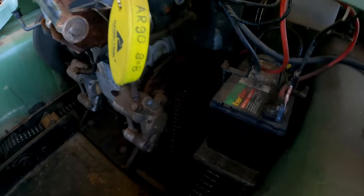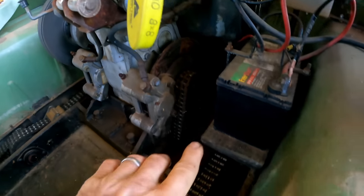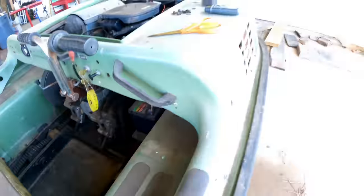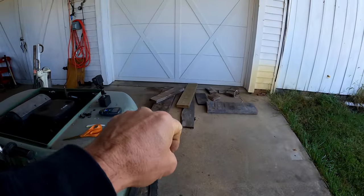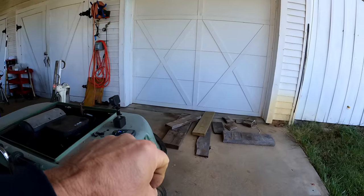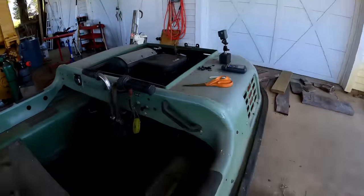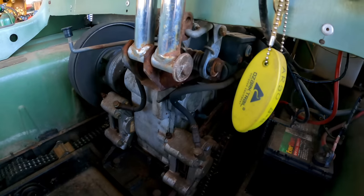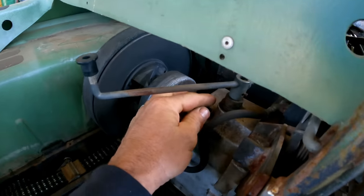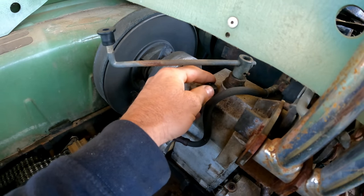Well, when you pull this lever, it engages the brake on this side, so all the power through the differential gets transferred to the other side, and these wheels will stop spinning. So it's like a bulldozer, or almost the opposite of a Z-turn. You pull back, you're going to go left. You pull back with the right, you're going to go right. So pretty simple design. And right here is the dipstick, it screws in, for the transmission.